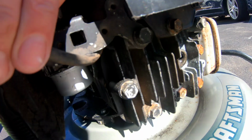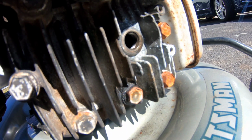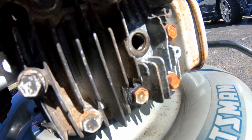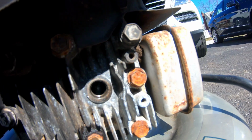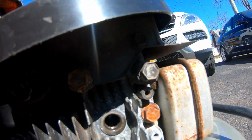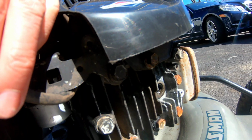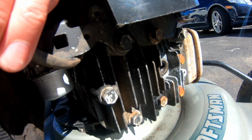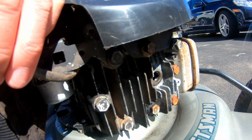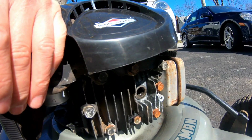Taking you a little bit closer here. Look at the evidence. Look at that bottom bolt, how there's some wet oil there. Side bolts over here are very rusted, right? Maybe the piston rings are scored, maybe the gasket's busted. But let's try one thing really simple. I'm just gonna tighten these bolts with a 1/2 inch impact.